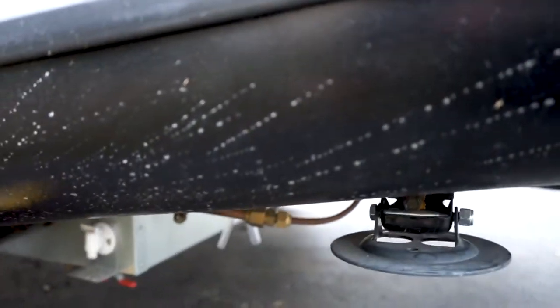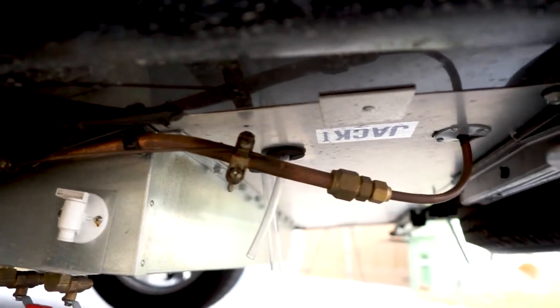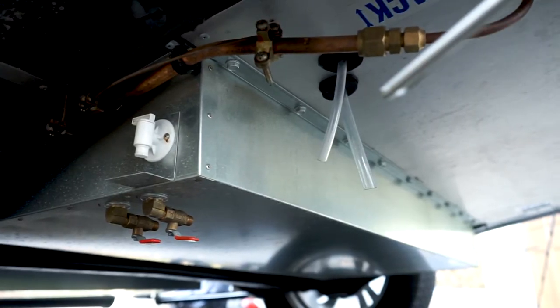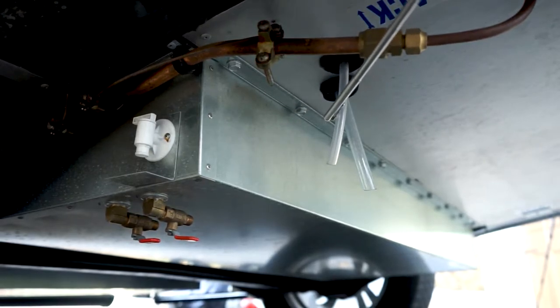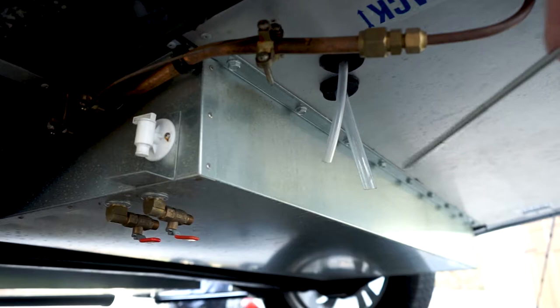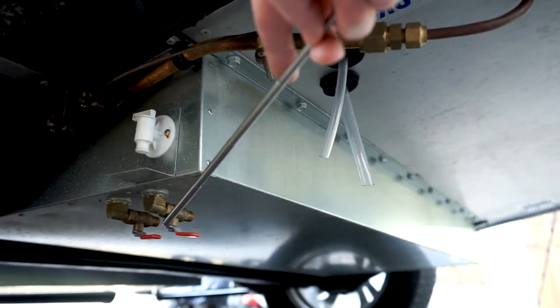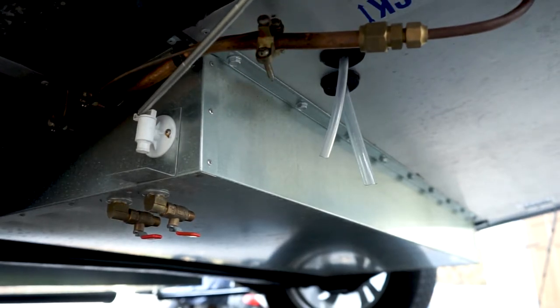Let's come around the driver's side of your Base Camp and take a look underneath. You've got several pipes, several valves, several drains — I'm going to explain what each one is. Towards the spare tire, this is your hot water pressure release valve. Under here behind the tire, the copper one is your LP pipe for propane that feeds the water heater. This is an air inlet pipe for your fresh water tank. Back here is your drain pipe for your hot water tank heater. These are your low point valves for your hot and cold water lines — this is the cold and that is the hot. And here is a drain valve for your fresh water tank.